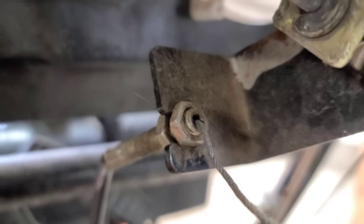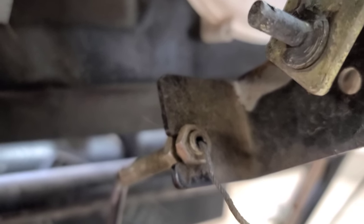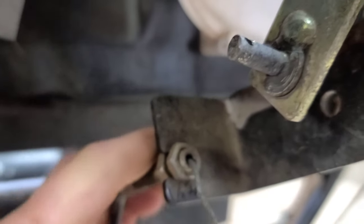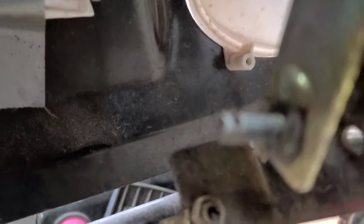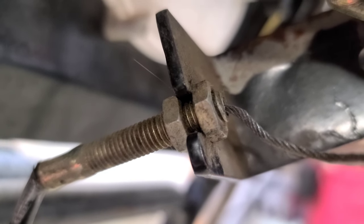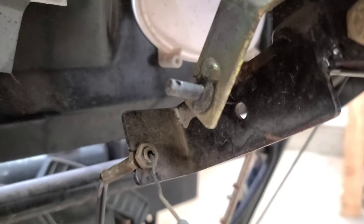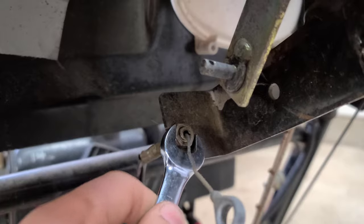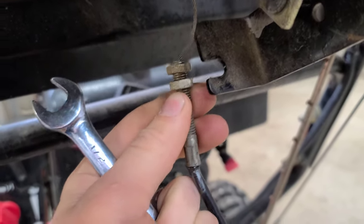And then this should be able to slide out but it is locked into place. So we're just going to get our half inch wrench and go ahead and loosen up the nuts. We're going to remember the point of how many threads you have out here because that will be important when you go ahead and install. I think this cable might be slightly unadjusted, so we're going to adjust it while we're at it. Let's go ahead and loosen up this nut here — that should free up the connection. So now we can take the whole cable and take it all out.